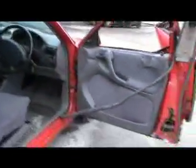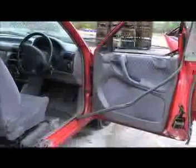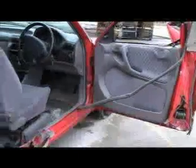Now all that will be left to do — we can either tie that whole lot off, the doors and the B-post, tie it out the way, or we can get some manpower to support the weight and cut the front door, spread it off at the hinges — thus leaving the whole other side of the vehicle totally clear.